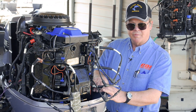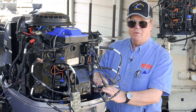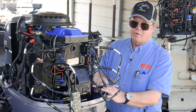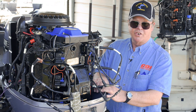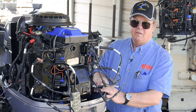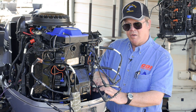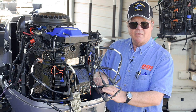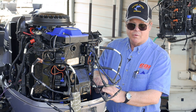Now, if you had one that was running smooth at idle speed, as long as you keep a load on that engine, you can rev it up to high RPMs. But do not exceed 2,500 RPMs on a hose as the engine could run away and you'd be unable to shut it down. From a safety standpoint, please do not do that. You can back it down in the water until the cavitation plate hits the water and fire the motor up, and you can bring the RPM up safely because the engine would have a load on it with the propeller. Otherwise, it needs to be on a dyno. Thank you for watching.